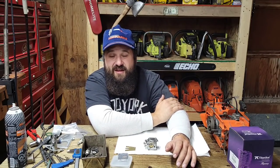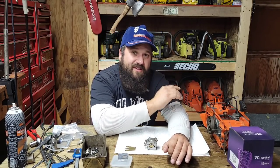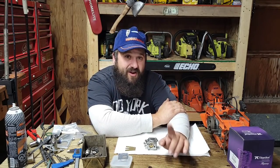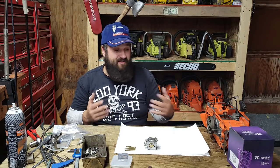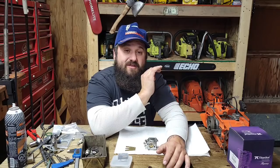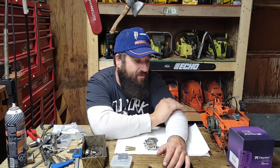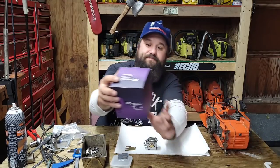Well, if it was 68 and I added 5, it would only be 73. When I retimed the cylinder, I would have seen that my timing numbers are off. So it's always good to recheck. Everybody makes mistakes, including me. I do it all the time. Sometimes you just misread a wheel or your zero wasn't quite right. And that's why I tell you guys, recheck your zero, recheck your numbers. You won't make mistakes then. So that's the deal there.